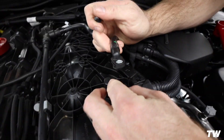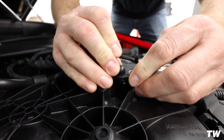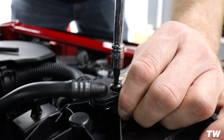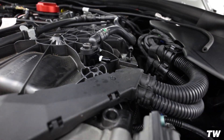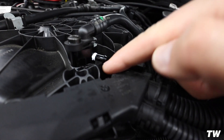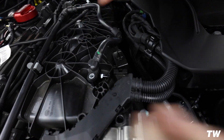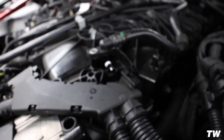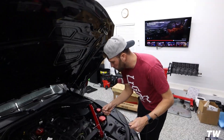We're going to drop this guy in with the O-ring down, then drop the O-ring and pipe on top — we stack them. We're going to drop in the new extended T25. We noticed this little nipple is hitting the plastic, so what we're going to do is just Dremel out a tiny little notch right here, and that will allow this nipple to accept the new boost line. We just notched this out — it's a little plastic fin, not going to hurt anything — so we can run the boost line into this nipple.